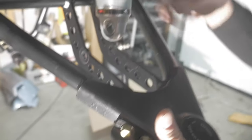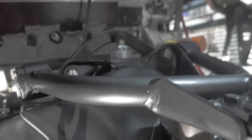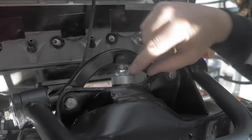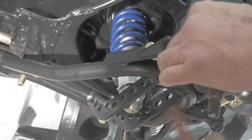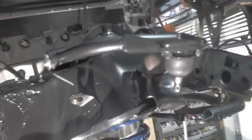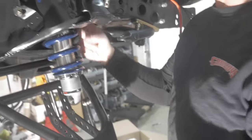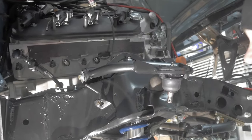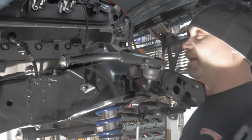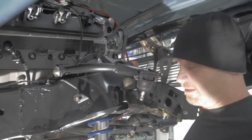One more thing I've been talking to Rytec about: there are no instructions on which bolt hole to put the coil-over mount in, but when we called them they said it goes in the half-inch hole. To push the coil-over all the way back in that position, you actually have to cut your frame. Now, if you look at the angle of their upper bushing — it's a nice ball bushing with a billet collar — if you were to put this coil-over parallel, it would naturally want to land in the third hole, which is a five-eighths hole, and the shock and bushing would all line up with even wear. But to get it in the half-inch hole they want, I'm going to have to cut my frame and the upper bushing is going to hit the frame as well — metal to metal. I called them and said, 'Are you sure that's where the engineers want it to go?' They said yes.